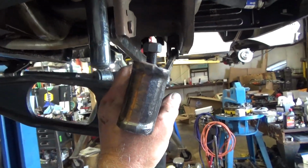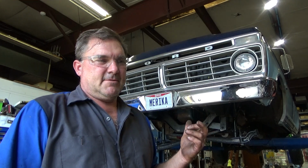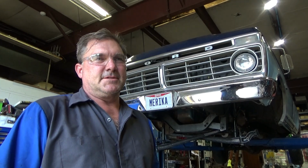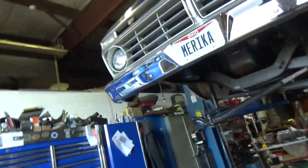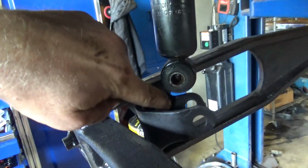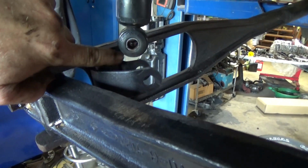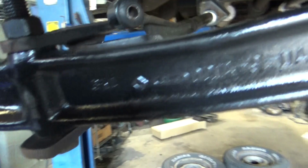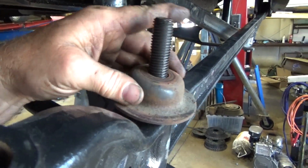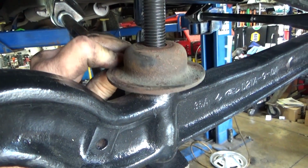So this is frustrating. So AutoFab.com have made this kit. When you go to their website, there's nothing. It just doesn't go anywhere. The directions are basically just verbal directions. There's no deciphering of what goes where. And I just put on the arms, and I put them on with the shock mount up, because in my head that made sense, especially with it being a lift kit, that it's got a higher position. But the arm has a longer piece here and a shorter piece here, which I think the longer piece needs to be up, because this is our shock or spring pocket and it doesn't fit correctly.